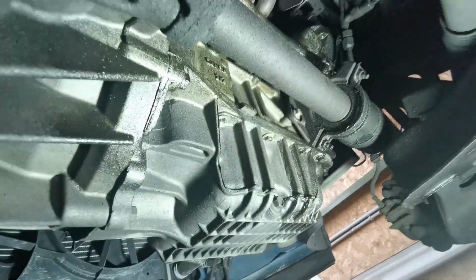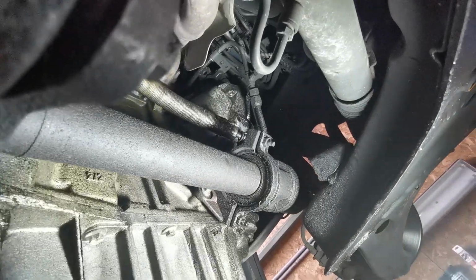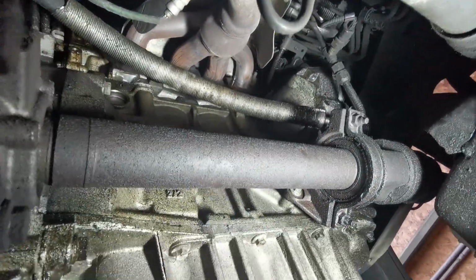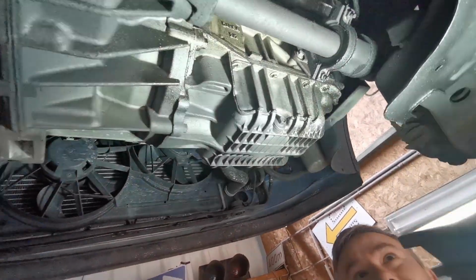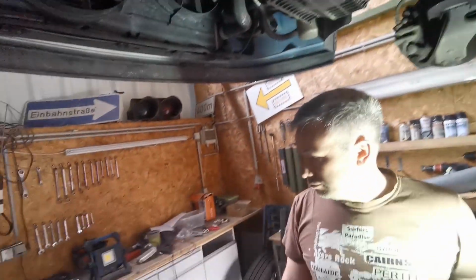First inspection underneath, we can see where it's nice and wet up there. We suspect that it's a power steering pump, which would be right there. But we can see it's even wet further above, and the guy we bought some unpimping parts from said it's probably the valve cover gasket, and it looks like he might be right.